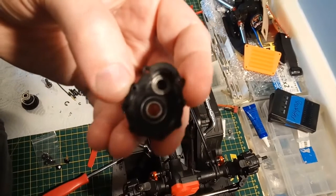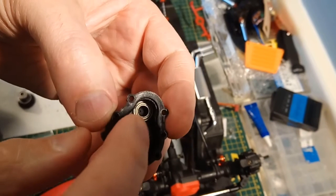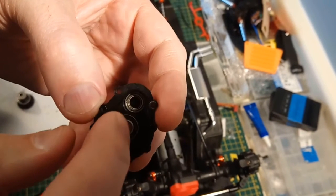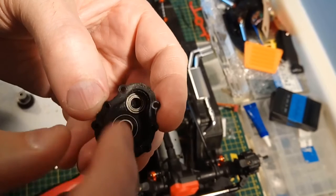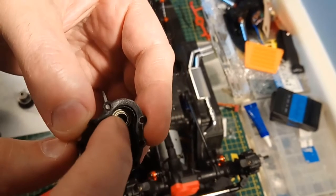The portals are very, very similar. This is the bearing for the input gear, and the shaft that goes into that bearing on the Injora is bigger than the one on the Traxxas. So that bearing is different.